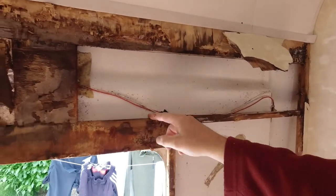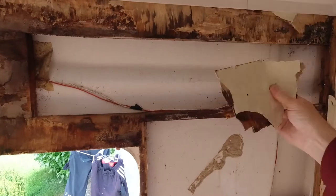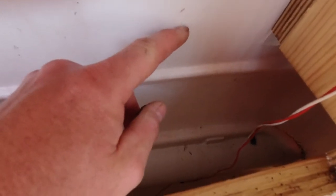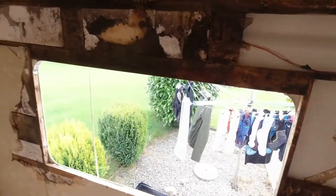It's totally saturated — you can see where water has been gathering on this top rail where the window frame was, running all the way across. It's such a tight fit that water finds its way through by capillary action. Going down it's not so bad. Inside the cavity you can see the back wall of the caravan externally. There's firm polystyrene around the light clusters for body firmness. The soft bits are coming off easily now, but the dry bits are coming off in small chips — this might take a bit longer.